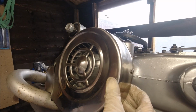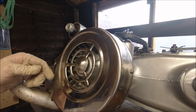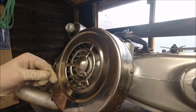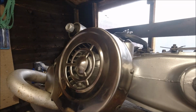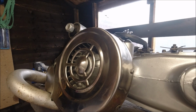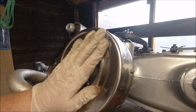With the wider cowlings, a lot of the people don't realise, but the back floorboards will rub. It's like got like a V. I'll get a floorboard out in a bit and maybe another video and show you. But you just need to take that edge off, because when the engine moves, it moves this way as well. They're only rubber mounts, and that's been touching there on a floorboard. So you just take the edge off the floorboard. On my GP, that's got stainless steel floorboard, and it was already cut away for a wider fan casing.